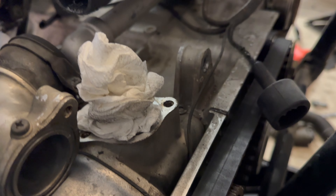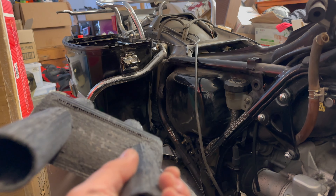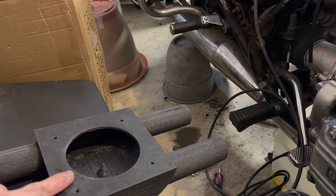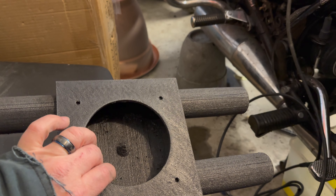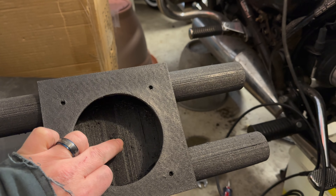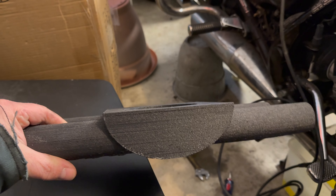From the first draft I've learned that yes, it will clear on the bottom - that's good. Maybe I could make these tubes bigger, though I should probably cut them back - see how they kind of shrunk because the temperature wasn't high enough inside the chamber, so the ends pulled up a little bit and shrank. I'm thinking I'm going to make this wider and maybe a little bit taller, and the throttle body uses a lot smaller than 100 millimeters so I should just go ahead and make the hole smaller. I put a little cone in the center - the air coming straight down will hit that and kind of get shot off at a 45-degree angle.